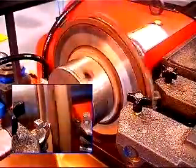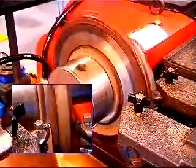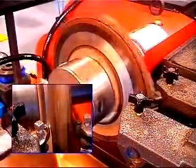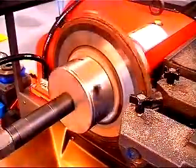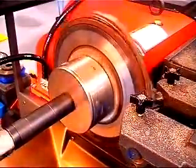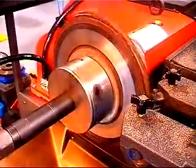This composite rotor is having 4 thousandths of an inch being taken off each side with no chatter or noise problems. Proper lathe setup and quick chuck adapter make this possible. If we add these features to the quick chuck adapter, you can see how this one tool will meet your present and future hubless rotor refinishing needs.